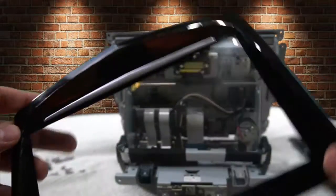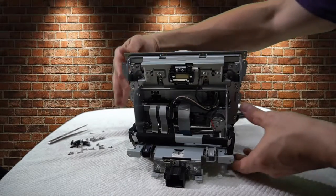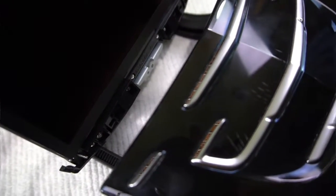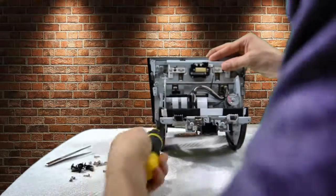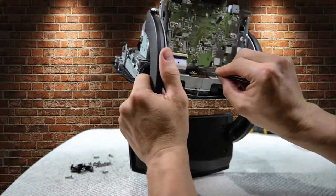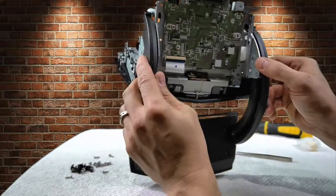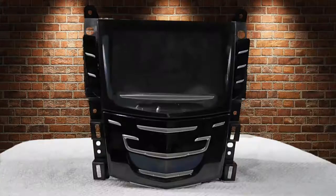Now the ribbon at the bottom of the screen is the one that you had to delicately take off earlier. So we're going to show you when you go to put it back on where you have to slide it through and then slide it back in just to make sure it's good to go. You can see right here we're going to flip it back over and get it ready to go. So right here is where you want to put that ribbon. When you're putting the new screen back on, you slide it right through that hole, and then once you get it on there you just tighten back up the screen and redo everything in reverse order the same way you took it off, and it should work like a charm. And I'll show you once we get right here where we're putting the ribbon back in. You want to grab your tweezers again and then just make sure you delicately push it in and then pull that tab back down on it. So good luck. Looks brand new.